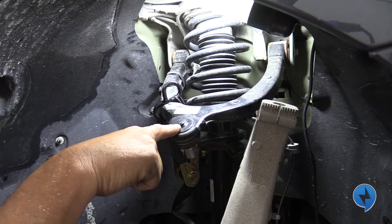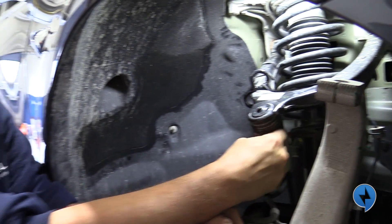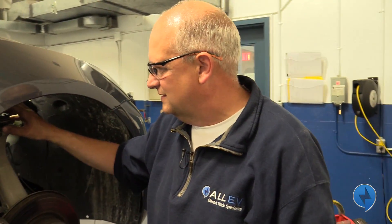Take it and just move it in a full rotation on the vehicle. You don't have to remove it from the vehicle — you can just drop it down to work the nut back on. So it's a quick, easy way of getting grease into the upper ball joint.